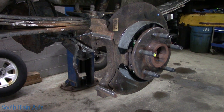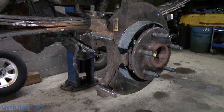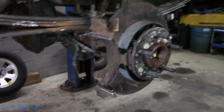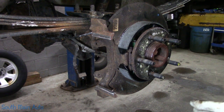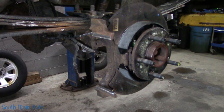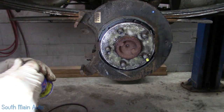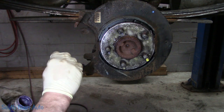We didn't get much schmutz on them so we don't have to get too excited about getting them cleaned off. The one spring is the most important thing — do not let it hit the tone ring. If it does, when you spin it you'll be like, 'What in the thunder?' If you want to put the spring on the back side, go for it. Before you put your rotor on, slather these babies up with grease otherwise you'll get it all over the rotor. So we're going to get these greased up.